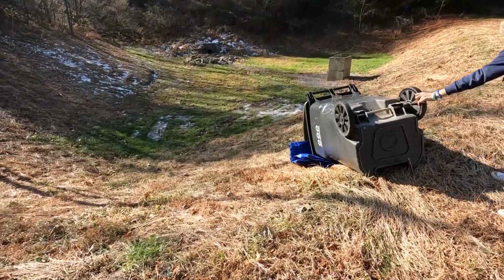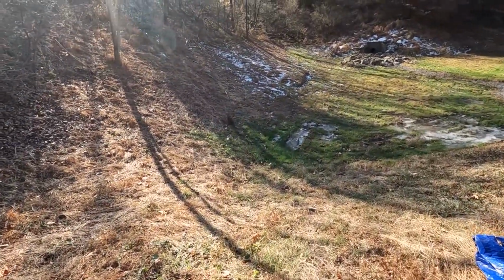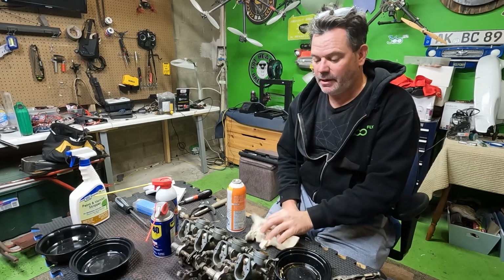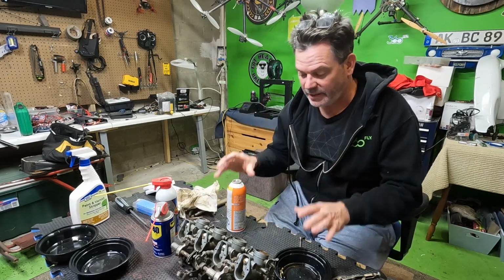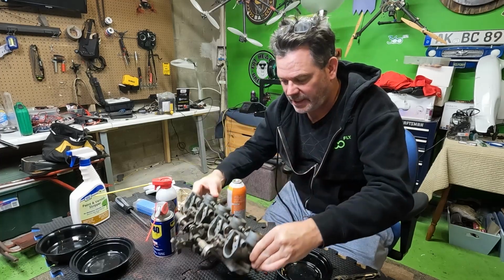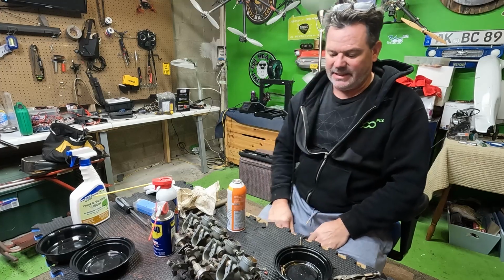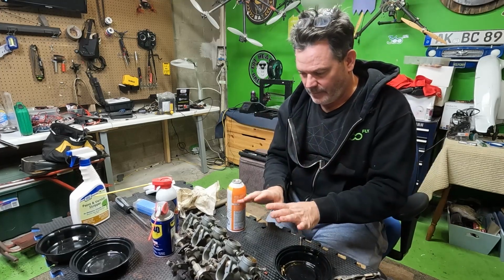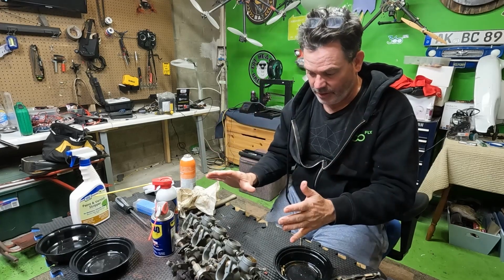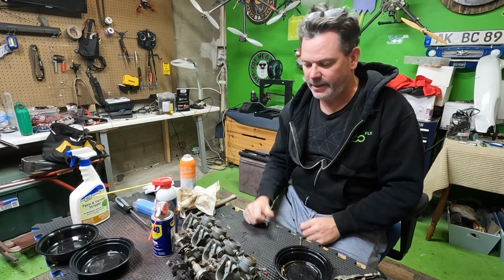And then released it across the street and have kept my garage shut for 3 or 4 days now. So I don't think it's going to come back. Hopefully it doesn't come back. But as for the carburetors, I know things can look overwhelming because it looks like a giant thing and there's going to be tons of parts. But the key to this is just to treat them as 4 individual carburetors, because that's exactly what they are. They're the exact same thing, stuck back to back to back to back.